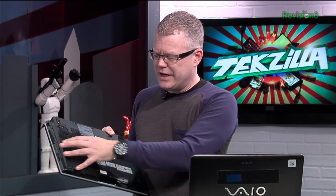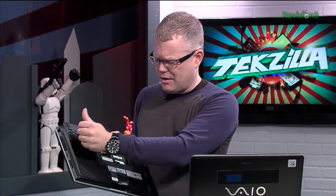I have an old notebook that doesn't have a dedicated hard drive port on the bottom, and it requires you to remove about 15 to 20 screws — that's a far more difficult upgrade. When you say port, you mean like a lid you can unscrew. I actually just upgraded — Liz, one of the folks who works at our studio, had me swap a hard drive and it was 27 screws to open up this MacBook Pro because you had to pull the entire bottom off and the top off. Have some good tools if you're going to go down that route, and I cannot stress enough — you want a nice clean workspace so if a screw goes flying you can hopefully find it. Things like painter's tape: put a strip down on the table and stick all the parts to it. You have less of a chance of losing stuff. Also, the ports on the bottom of the notebook are all labeled. I'd recommend exploring a little — take them off and see what's under each one. You might find ports you don't need. On this particular notebook there's actually a space for an extra hard drive. Just make sure you don't lose your screws and get everything put back the way it was.